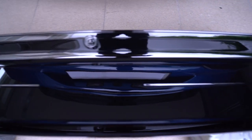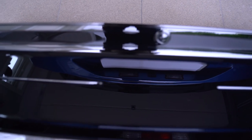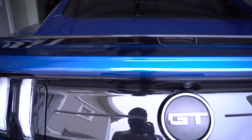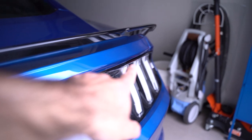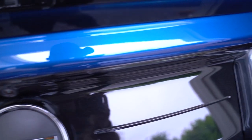Look at it — so much cleaner than whatever is installed on the car now. So much better. We also have a cap for the camera, for the rear-view backup camera, so that we need to replace as well. The installation is quite straightforward. There are four bolts on each side underneath the trunk which we need to remove. The tricky part is removing the deck lid panel because there are metal clips which we need to pop off. We want to be careful not to scratch anything on the actual deck lid, so we will use tape or some microfiber cloth while using our prying tool.